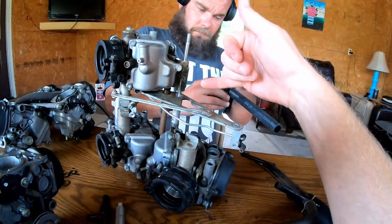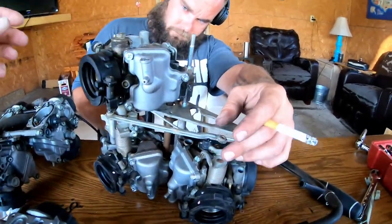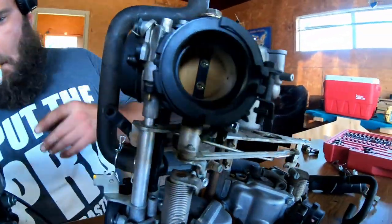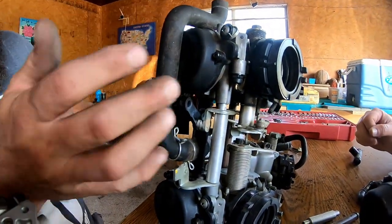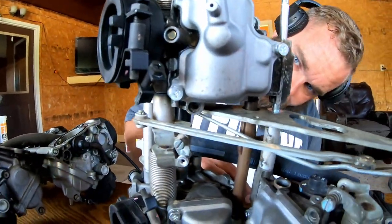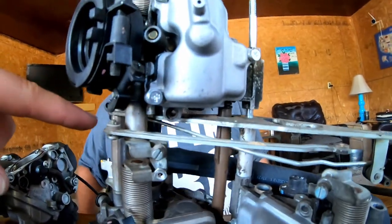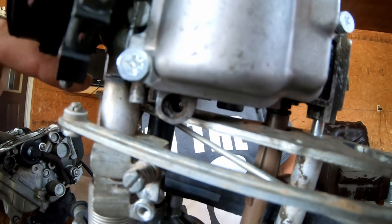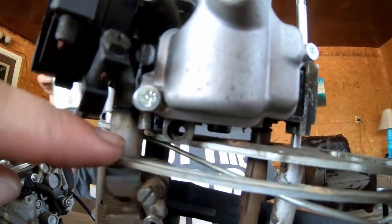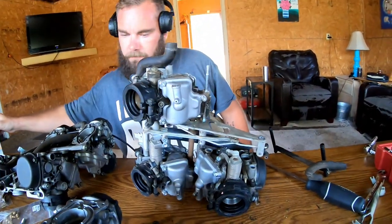So, when reassembling the entire carburetor pack, this framing bar has to be put on at the same time as this carburetor so that it can slide together all in one piece, because it has to be behind the throttle. There's a little bit of a groove up underneath there. It's approximately here on the other side. And that is not going to go on unless you slide the carburetor in just a hair before. You actually have to have this in place right here on the carburetor as it goes on to this mainstay pole so that you can slide it down and get it to fit.